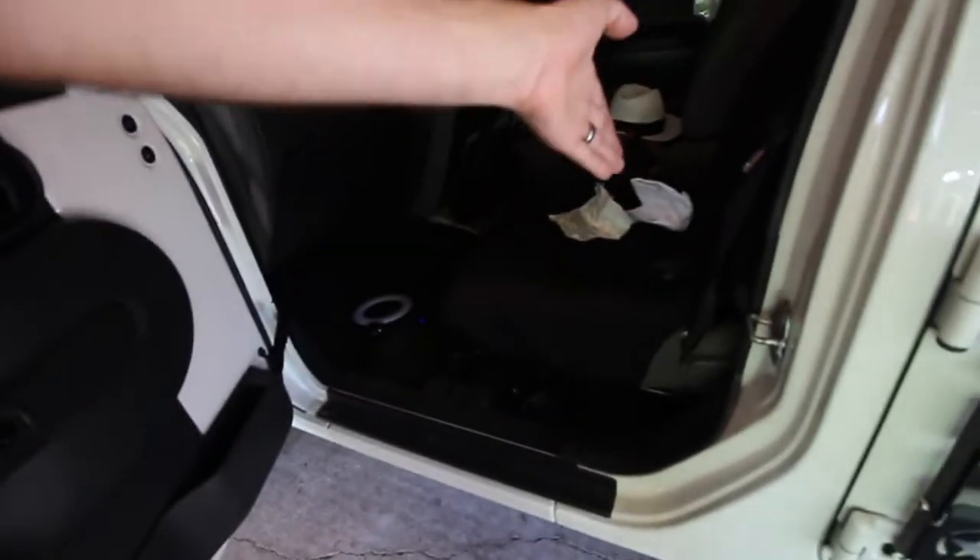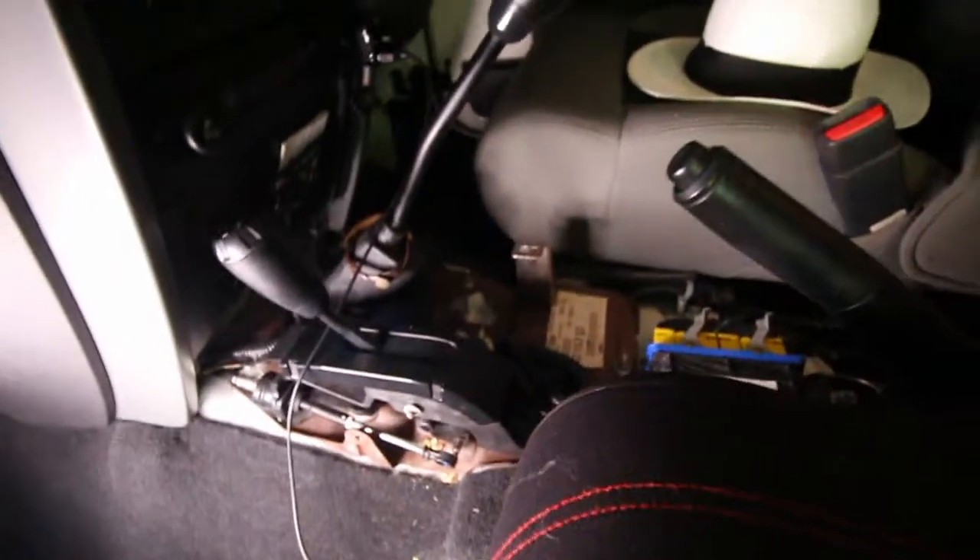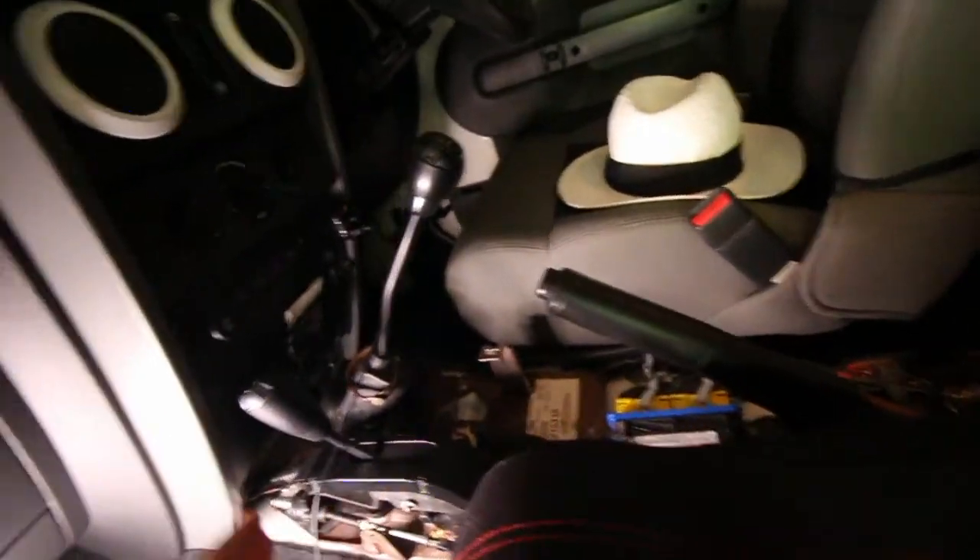I thought I would get these off eBay but check your Jeep dealership first. There is one underneath the Jeep as well, kind of in line with where the transfer case is, near where your gear stick sits - check that one as well. The first one I'll be checking is the one inside the car underneath your center console. I bought four of them for a dollar fifty each. It's just a little plastic bushing that's broken inside the transfer case linkage on the outside - not internal, super simple.